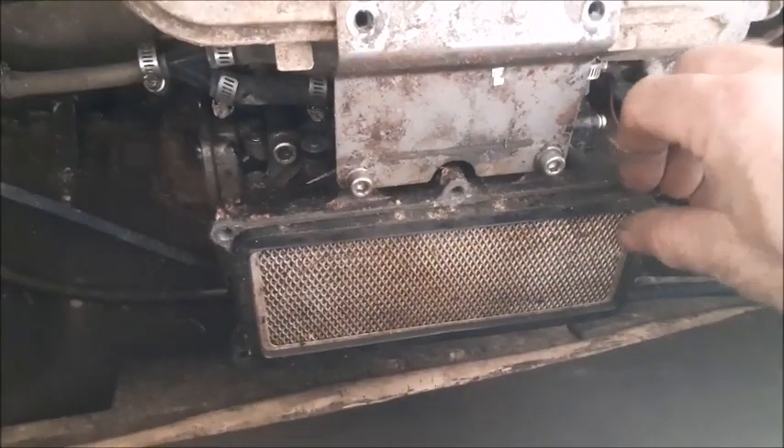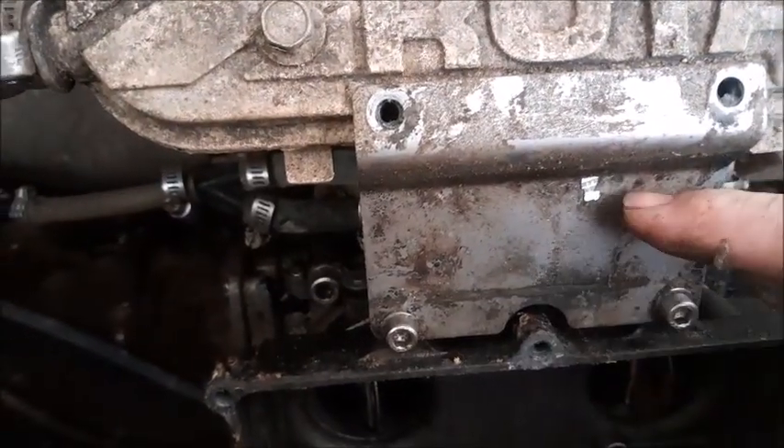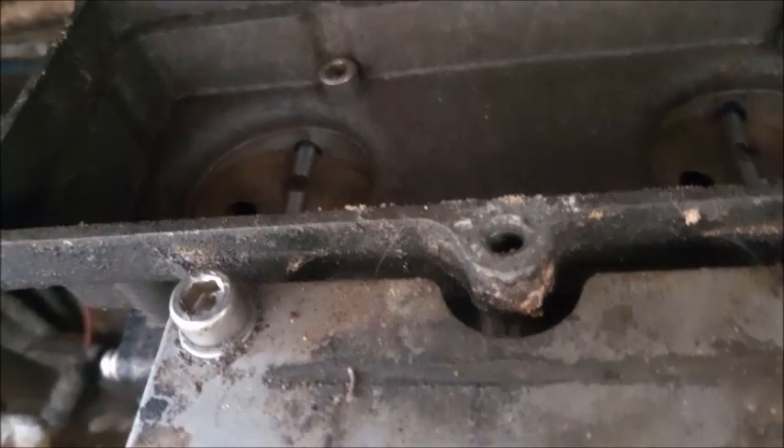This metal screen with rubber edges will lift right out of the carburetor sockets. Now we'll go ahead and take these last two bolts out of this bracket — there are four bolts in here that hold this collar on. At this stage it's a good idea to go ahead and turn the choke on so you won't drop any parts down the barrel of the carburetor.